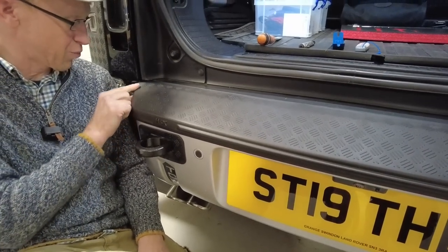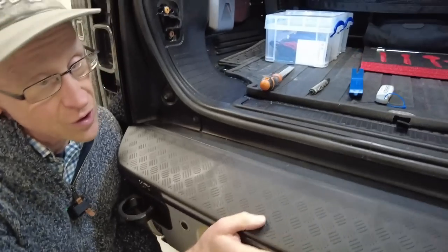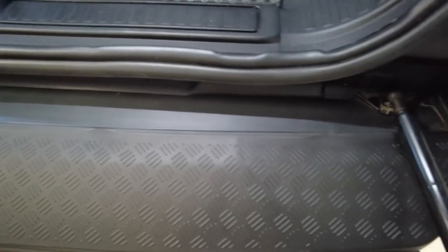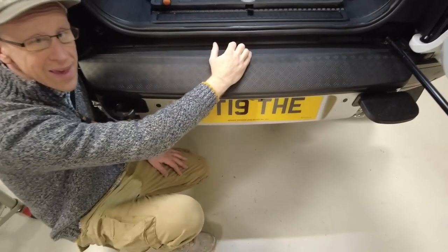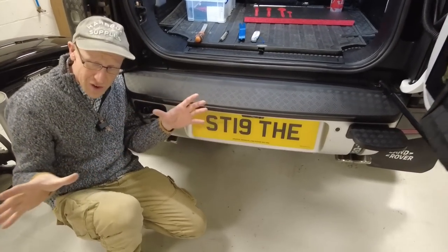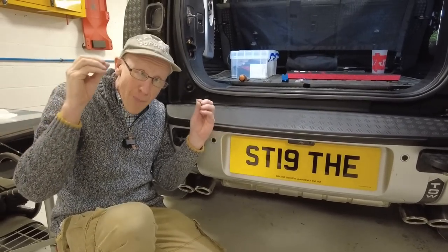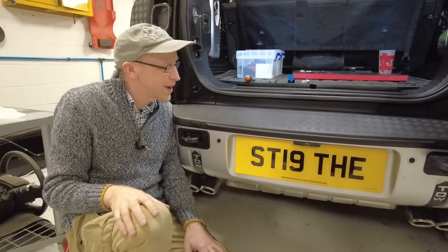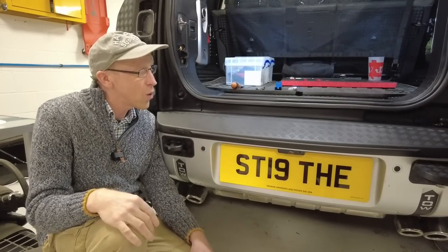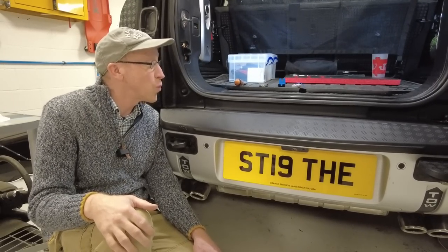Comes on, we've got our HSX branding. It comes around the corner and it meets this panel at the top. Now, it turns out making long bits of plastic is quite complicated. So when you injection mold a piece of plastic, this is injection molded, when it cools down after being molten plastic injected, it does shrink a little bit. And we have been playing with the shrinkage rates on the plastic quite a lot, which is why it's taken us best part of a year to get this into production.